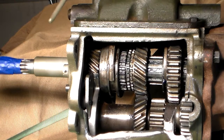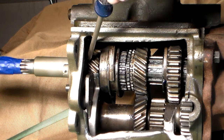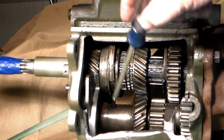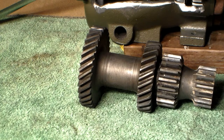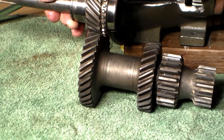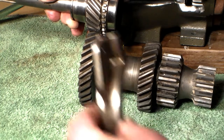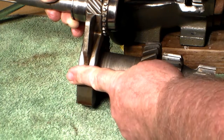When the main gear is installed inside the transmission, it fits through the front of the case, and you can see that helical cut gear here. It intersects with the cluster gear. Those two will be installed in the transmission, they will intersect and mesh. You can't see it very well inside the transmission though, because of the oil collector, which is installed inside the case — it fits in like this.